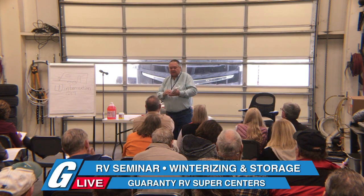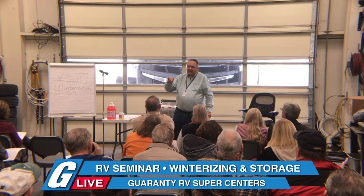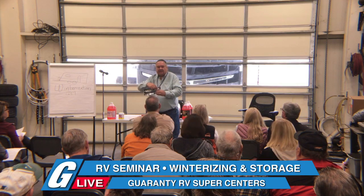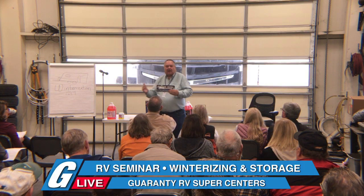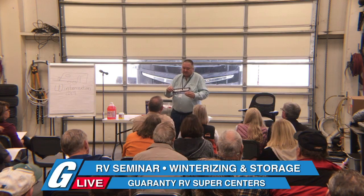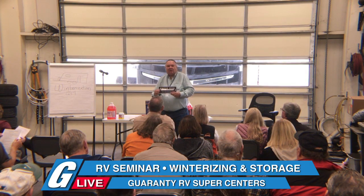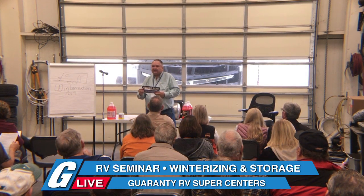When you take it out, if it is shot, it looks like a welding rod. There is a steel rod in the middle, and it's corroded. People bring these in all the time, and there's a little gone here, a little gone there. No, you use it for 4 or 5 years. When you winterize, you take it out, rinse it off, and leave it out. It'll dry, and then next year you put it back in when you de-winterize. You wear this, it'll eat down until there's almost no rod left, and that's when you want to replace it.